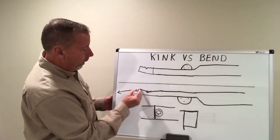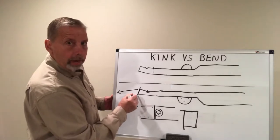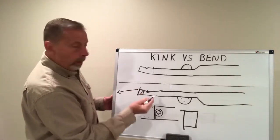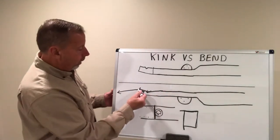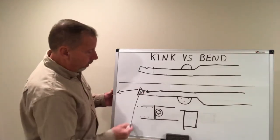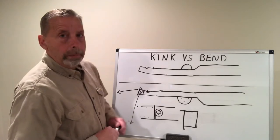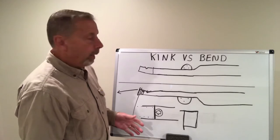The closer you get to the front of this, sometimes you can just buy the end cap, which is a sacrificial piece — take that off, and if it's a small bend you can get in there with a little porta-power and work that out. But the main thing with these videos on kinks and rails is just the way that you need to pull on these to relieve the kink. You don't grab and just pull off to the side. You have to take all these things into consideration, and don't make the decision on your own about what you're going to do with this rail.